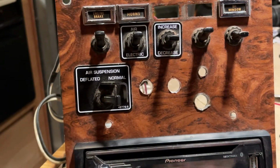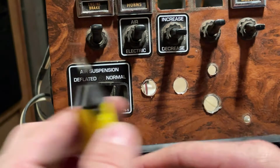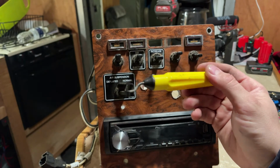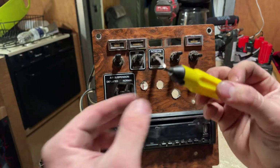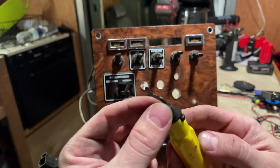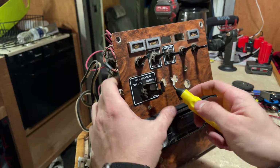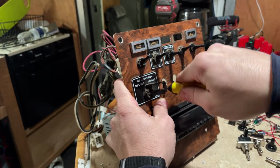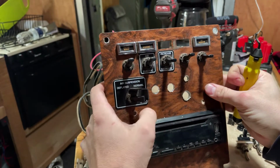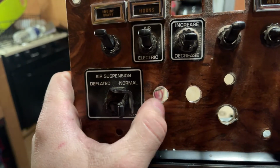All right, so we got both our holes drilled, as you can tell. Now you notice it's got burrs all over the edges of it. This is a pretty nice and easy, cheap tool known as a deburring tool. Little round blade on the end. You see I've used mine pretty good. And they can be found for a couple bucks at Harbor Freight, Amazon, Home Depot. But for when drilling holes through metal, just take it and wrap it around the edges like so. And it puts a nice little chamfer on the hole you drilled. And silky smooth, no more burrs, nothing to get caught on.